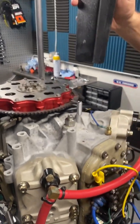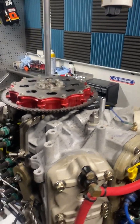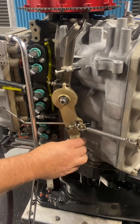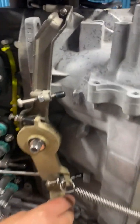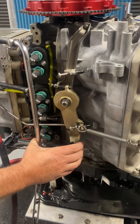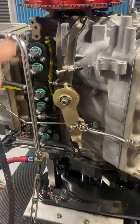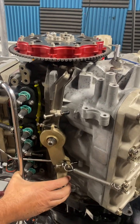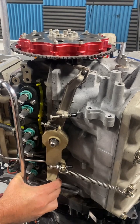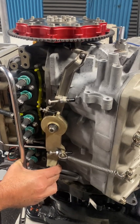Now we're back here with this hooked up. You need to advance the throttle — the best way to do this is in the boat. If you look at this arm, we're effectively changing the timing by doing this. You want your buddy to sit in the boat and push the pedal wide open throttle. You're going to have the kill switch on, fuel pump off, and crank the motor. You need to be with this touching the stop with your buddy wide open on the pedal. Tell him when you're clear of the flywheel and ready to crank, then hit your mark.